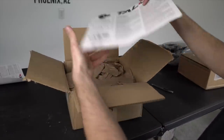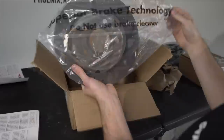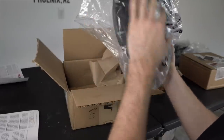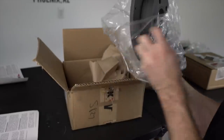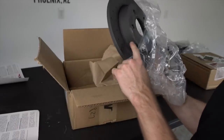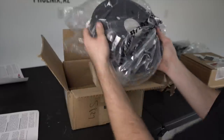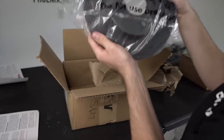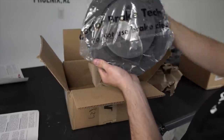We can see the rotors and which way they need to go. Do not use brake cleaner. Normally when you get brake rotors out of the package you'd want to use brake cleaner, but these are not normal. These are already cleaned, ready to rock — they don't have any oil on them. So if you get performance brakes and order from Hawk — link in the description for a kit ready to go for your Focus — don't use brake cleaner. Super important.